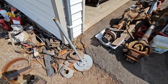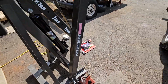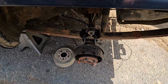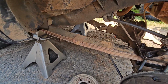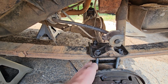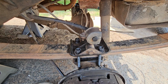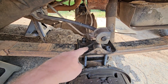So we're going to go ahead and use that one. And then let's see, front bumper's good. So then I jacked it up, and I replaced the leaf springs with another set like the ones that were up on the front. I put the 1-inch lift block, but the U-bolts that they provided are too short, and I got it cranked down all the way. I can't tighten it much more than this, so I ordered some new U-bolts.